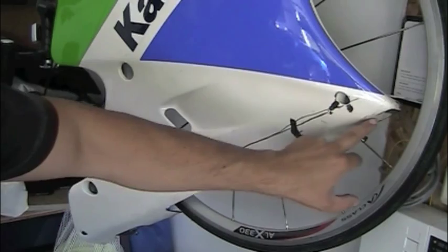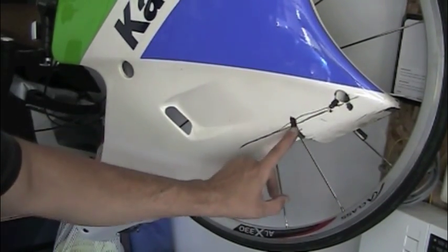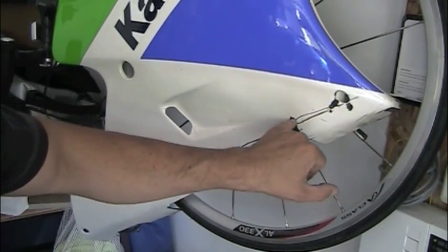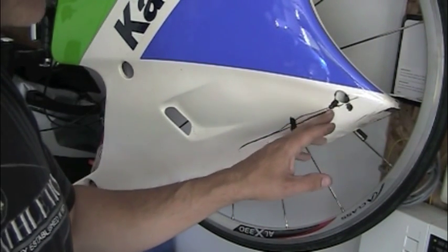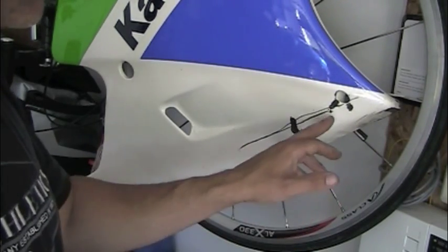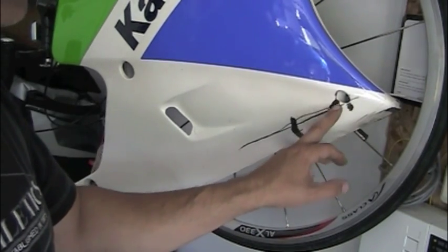You can see there's some damage here along the very bottom plane of the fairing, and the same goes for its matching side. Along the side here there are these long gouges. These were clearly an attempt to weld, and there are tiny holes drilled here, here, and here. It's a good practice when you have a crack in plastic or metal — to prevent that crack from expanding — to drill right at the head of it, a perfect circle. That circle prevents the tight stress and actually prevents the crack from expanding. So that's what this person did, and then they turned around and welded it up with either a soldering iron, a heat gun, or something.